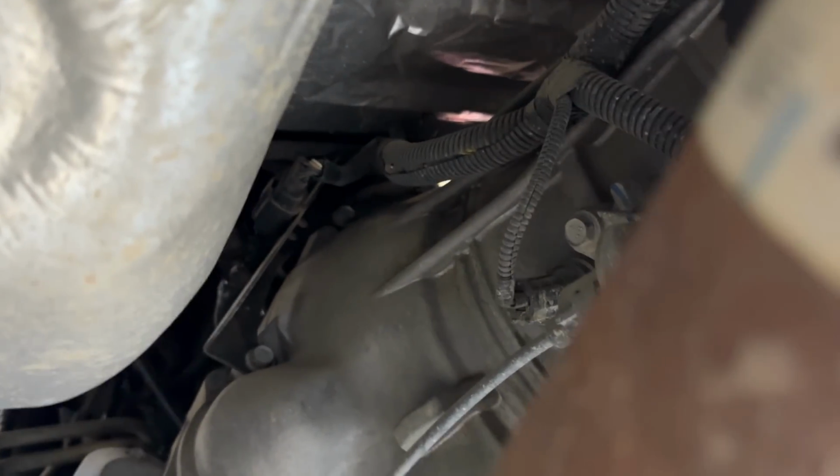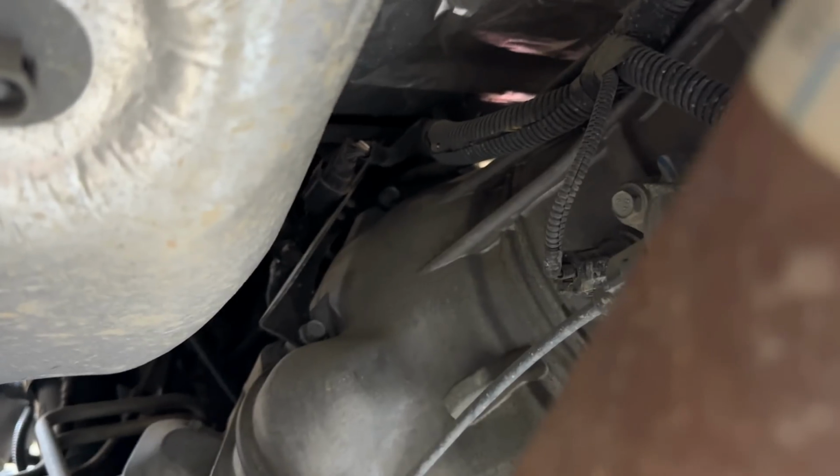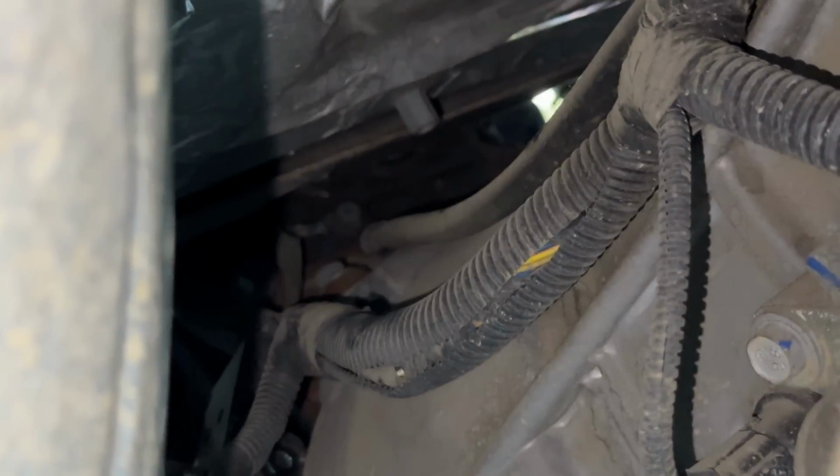And then you break them free. They're not super bad. Okay, for starters, we're gonna go ahead and remove, flipped you around there, sorry. For starters, the 2 bolts that hold that electrical bracket on, and then we'll be able to see the driver's side much better. I'm gonna get that removed. All right, now if you look real close, get you guys zoomed in here, we can see the 1 bolt right there. And then, so there's one right there, that's the vertical. And then this one over here is the horizontal. Very easy to get to with just a long extension and some swivel sockets. So I'm gonna zip that one out real quick.